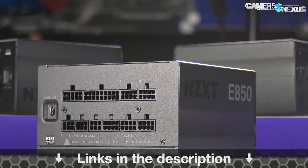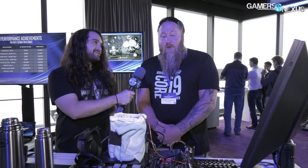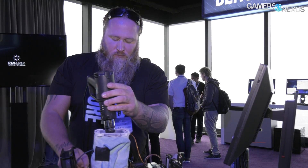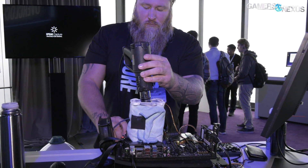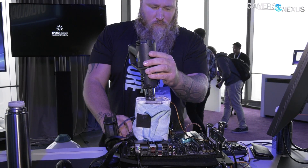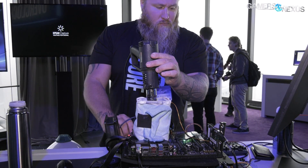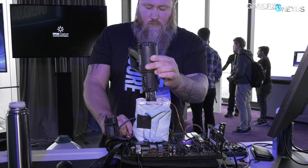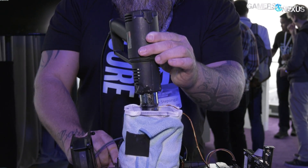Learn more at the link below. What have you had it running at stable? The other day I had it running about 6.8 — that's all eight cores on the chip, so it's not just one core pushing as much frequency. All eight cores at basically 6.8. Today, right now, since I'm having a lot of condensation issues, I had to switch boards and kind of get it up and running, so we're running about 6GHz right now.